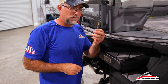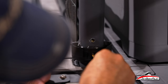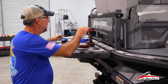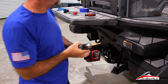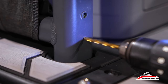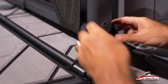To pre-score your drill hole location, it's important to make sure that you find the center of this hole. We're going to make a mark just using the drill bit — come in, find the bottom of the hole, tilt it up just a little bit, and just twist. Now that we've made the mark, take our part off. Take our drill bit — you're drilling into aluminum here, so you can run this on high speed if you want. Find your mark, apply some pressure. It is really important to get this hole right. Line the part back up — we're good there. Get the chips out of the way.